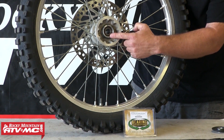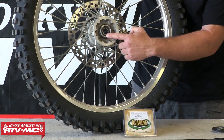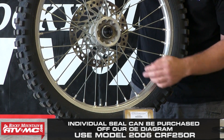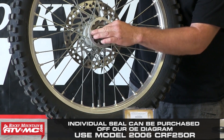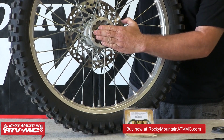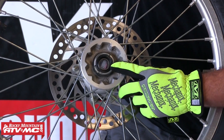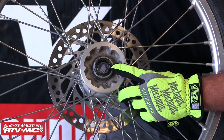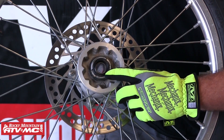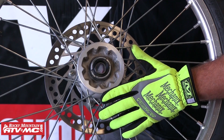On the front wheel, you can see with the bike, with the odometer, it has cutaways for the odometer to hook into here. So what you'll need to do is get a seal out of a regular 250R kit. We have a bearing connection kit here. You just push this in with a flat tool — smack it flat and you're good to go. Now we've pressed in the seal like so. Real simple deal. You can almost put it in with your hands — just a slight tap and it sits flush. You can put a little grease on the inner lip of the seal as you would with any seal. So now you're done with the front wheel part of this project.